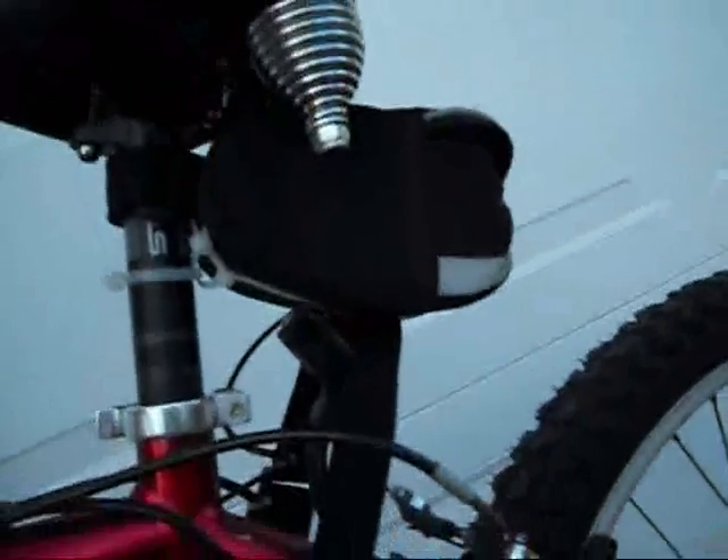So that's how you put a horn on your bike the right way. Definitely use a relay, because you won't get as much of a voltage drop, especially with two horns. Your battery lasts a little bit longer.